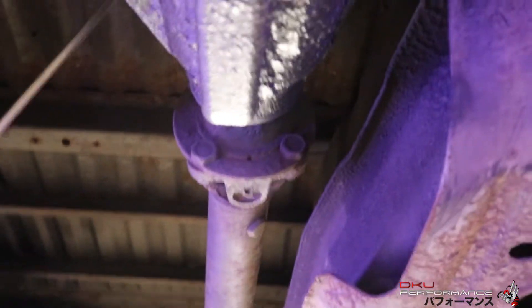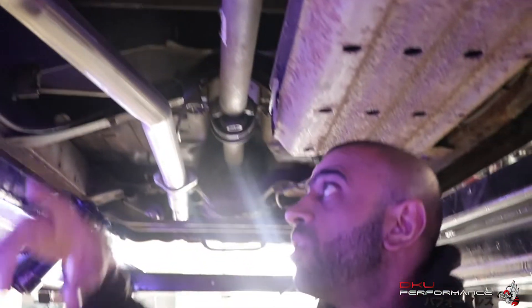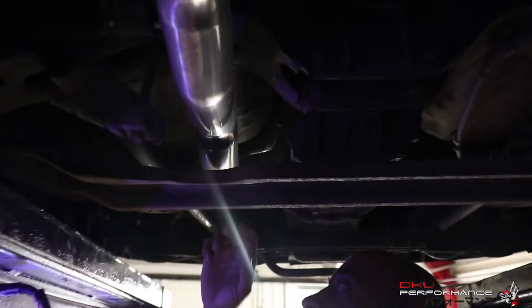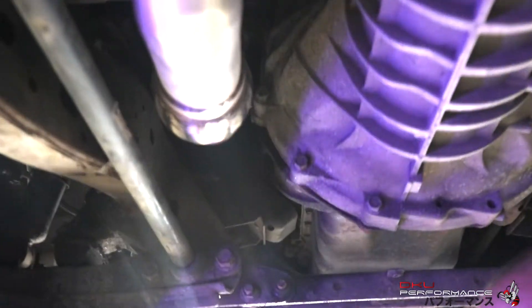The designer said this is the way it's going to be done, just for future-proofing. Two and a half inch middle section, flange once again over the front beam, flexi, straight away up to the turbo. No cats, no boxes. You could imagine what this bad boy sounds like — absolutely epic.